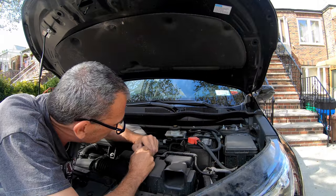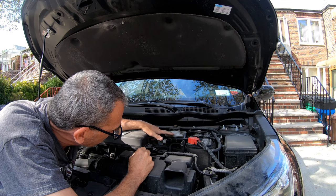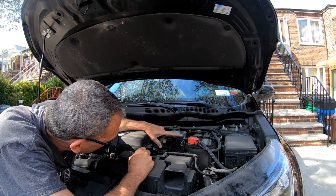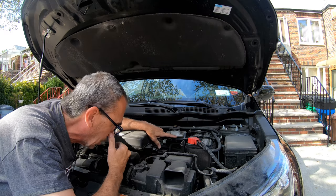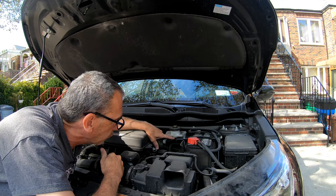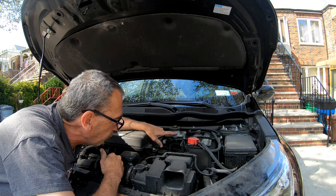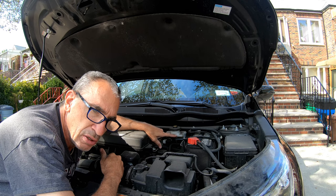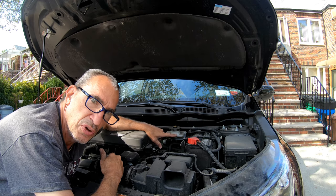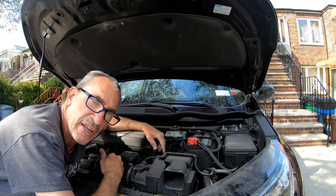Oh, most people don't know where to really look. There's the maximum line. There's the minimum line. If this thing goes low, that means your brakes are low, needs replacement. So always check your fluid. That's the hint of not taking the tire off. If it goes low for any other reasons, that could be a leak. You may never know. That's another way to inspect. I just thought I'd let you guys know that. Nobody out there really knows that. But there you go. Catch you all later on the next one.